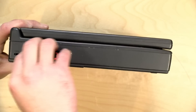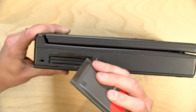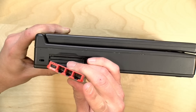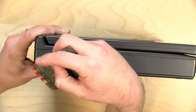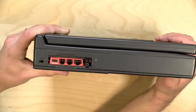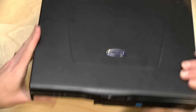On this side there's a network adapter plugged in. There were two PCMCIA or Cardbus slots — you could get two Type 2 cards or a Type 3 card taking up both slots, which is what this one is. This particular card has a modem with telephone pass-through and an Ethernet jack for 10/100 Ethernet. There's also another infrared port on the front. So lots of stuff on here.